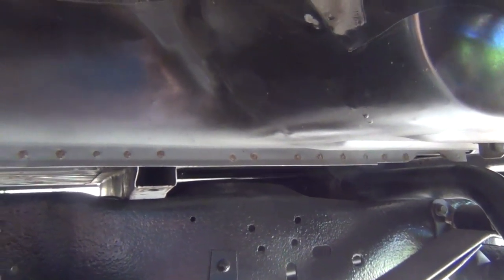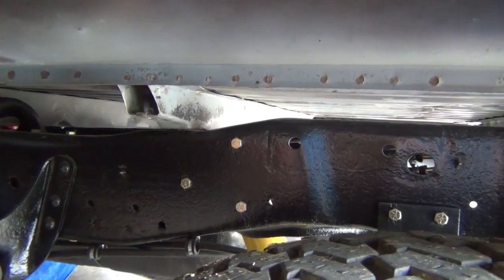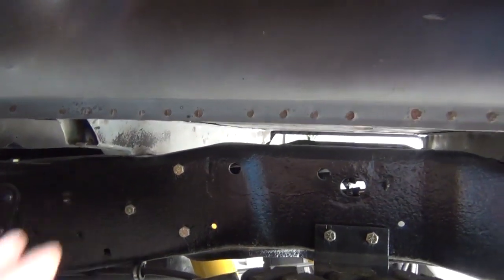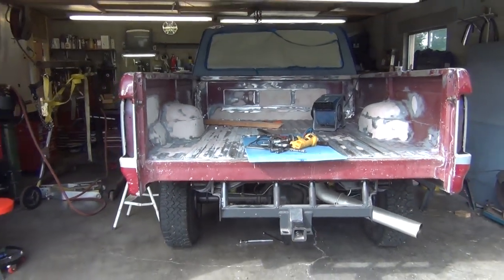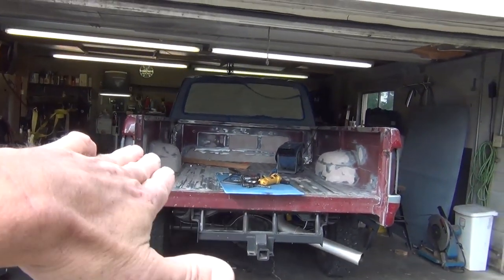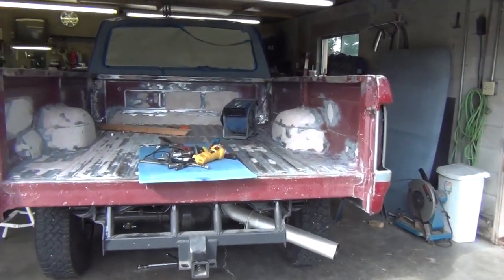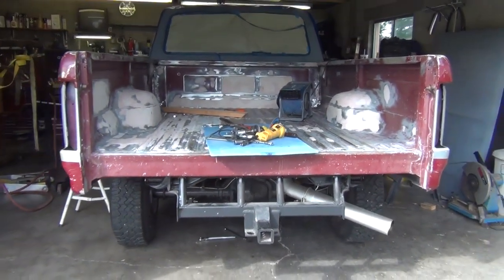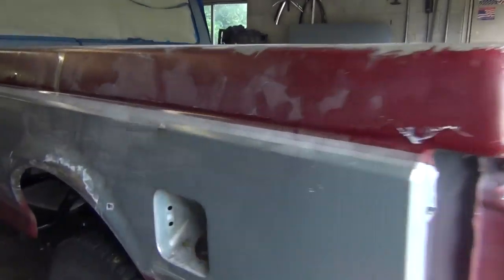That would be a good little trick to do to a truck you're going to work hard, but you don't really want to ruin the bed and have these braces collapse on you. That's what makes a lot of these trucks, if you get behind them, you'll notice the bed will look crooked, not even with the cab. A lot of it is because they've been hauling heavy stuff like firewood, rock, gravel, and the weight actually crushes those braces.